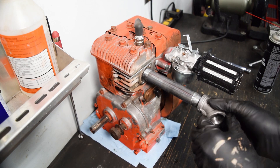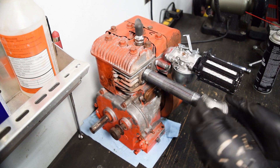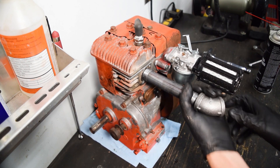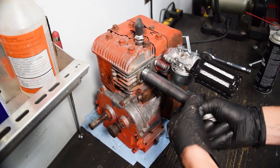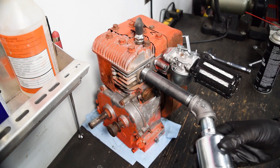The exhaust itself - since I wasn't able to get that exhaust stud out, we have to go with a thread-in style exhaust, which is just three-quarter inch NPT. So I got a six-inch section, a 45-degree coupler, and then a three-quarter inch muffler from a tractor or something. You can just buy this at any real hardware store.